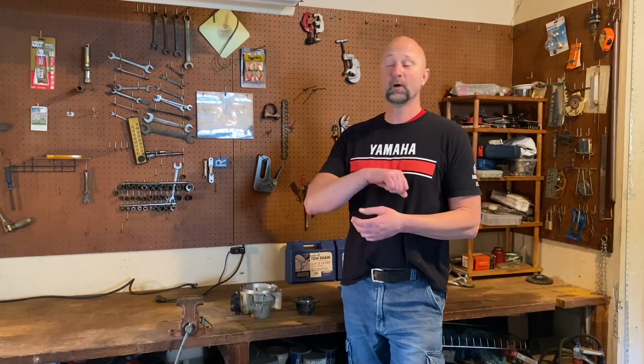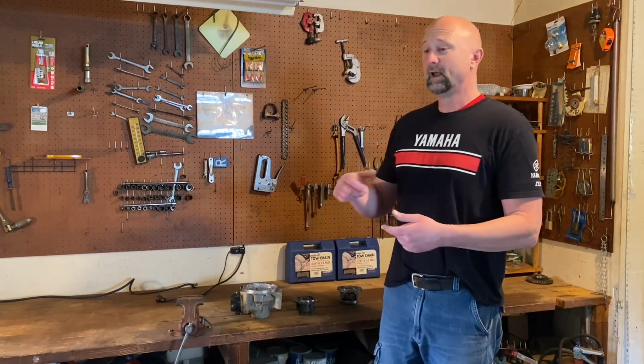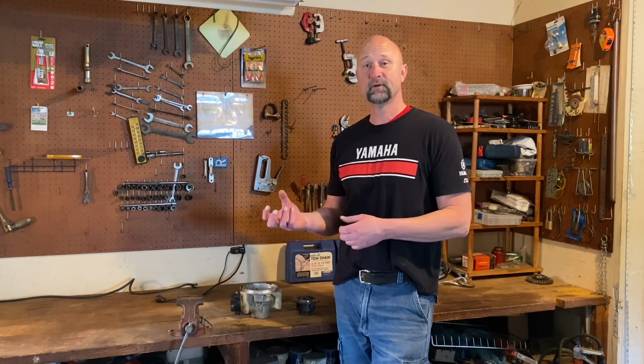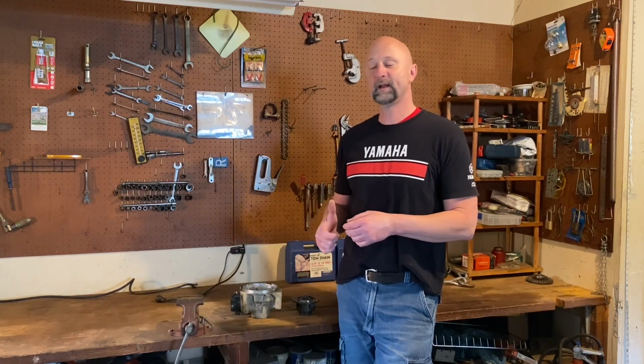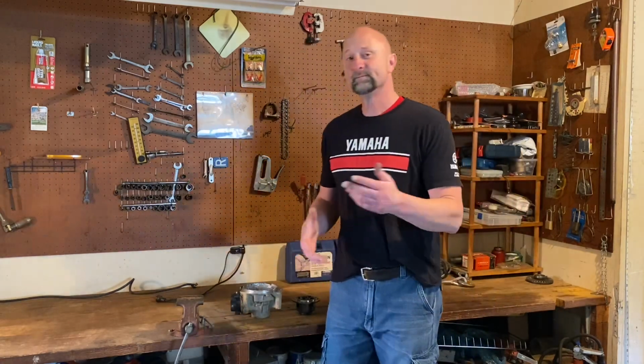It just involved me making a really hard cut to the right or a really hard cut to the left. And I guess when you got your front diff locked in, you got both wheels pulling at a continuous pace. And if you've got your wheel cut all the way in one direction, that's putting a lot of strain on your axles and on your front differential. So yeah, I didn't have it pegged, less than 5 miles an hour. It just involved my diff being locked in, making a really hard cut, having to punch it just a little bit to maybe give it just a little bit of gas to get over a rock. And both times in doing that, I heard the loud crack, got out, checked my axles were fine. Couldn't see any holes because the holes were hidden. But yeah, just to let you guys know on that front diff, it tends to be a little bit weak.